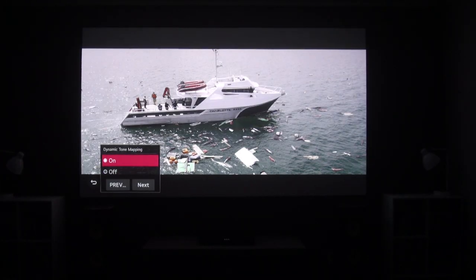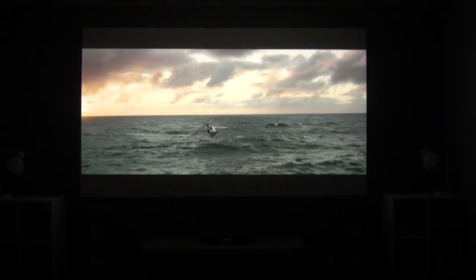One of the things I was really impressed about was the dynamic HDR capabilities, which above and beyond having that great wide dynamic range really takes the pain out of watching HDR with different types of programs. The auto dynamic HDR tone mapping does a great job of looking at the signal coming in and the projector's capabilities, making sure you always have a good solid image range. Bright scenes aren't pushed too dark, and dark scenes show all their details — highlights that might get blown out in projection are mapped into the displayable range of the unit.